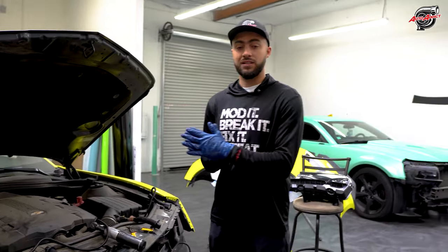If you do the opposite, which is a lot of mistakes that do happen, if you guys wanna get closer here to see, the yellow lines up with the black, and when you turn on the car and turn on the switch, the fuse is automatically gonna short and pop, and you have to replace it every single time.